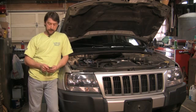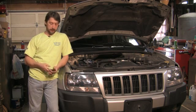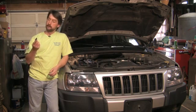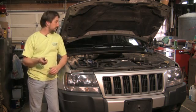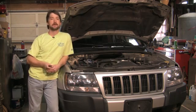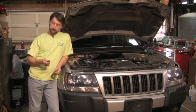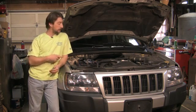There's just a little electronics involved. It's really nothing fancy, nothing high tech, but it usually involves a little computer and a little remote, a little key fob, whatever you want to call it. It's wired underneath your dash in between your starter wire coming from your ignition switch down to your starter. When you hit this button to start, it sends a signal down to your starter and up to your ECM to allow it to start.